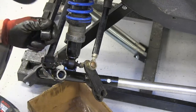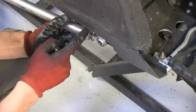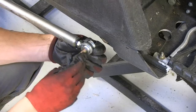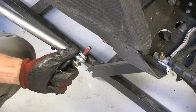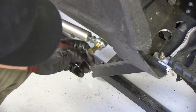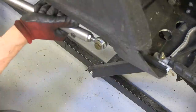Check all these bushings here to make sure they're not worn out — if they are, just replace them, pretty simple and easy to do. I noticed that if I just mounted this right up against there without any spacers, the arm is going to come in contact with the belly pan. So I'm just going to pop three washers in behind there and one on this side — just a little bit of room. One thing you'll notice is that the old bolt is much longer, but that's because the end of the old trailing arm was a lot thicker. So I just had to get a new bolt and we're good to install. It might still seem close to the belly pan, but as the ski is forced up, the arm is going to go out because of the length of the radius rods and it won't come in contact with it.